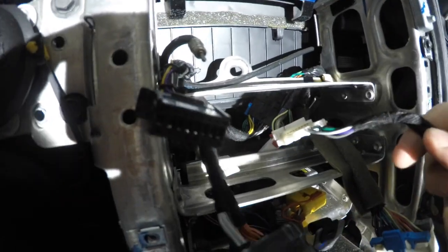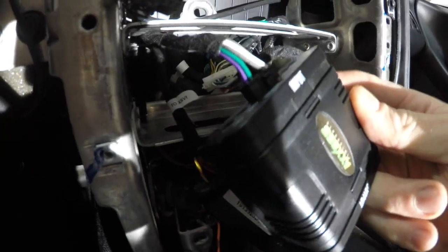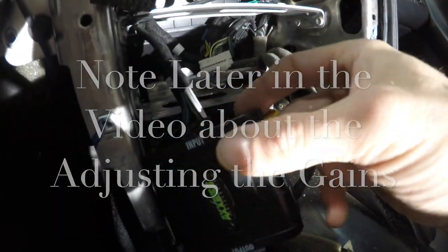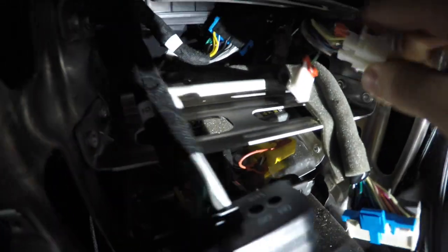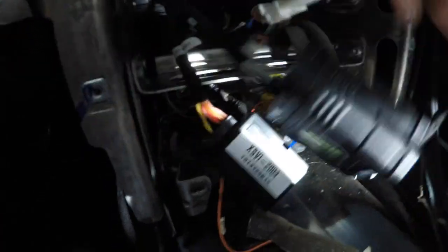To be clear, the two boxes that come — one has the speaker wires and basically looks like an amplifier with gains on the back side. You'll end up with one white plug that goes to the factory unit — it does not get used. Then the other plug comes into what I call the magic black box, and that's where the largest of the connections goes. That big black plug you take out from the stock unit houses the bulk of the wiring.